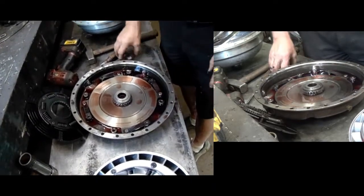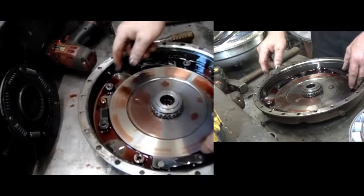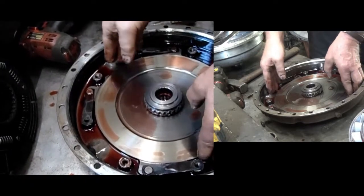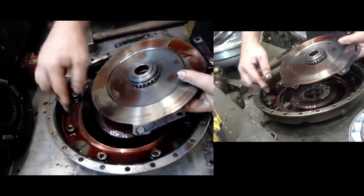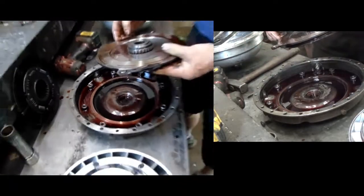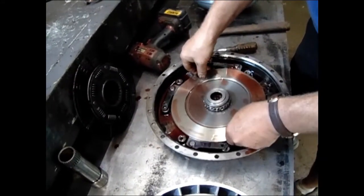I'll point something out because I've seen it many times, and in fact when I was younger and dumber I made the same mistake myself. This pressure plate here has to go in the right position. It's possible to install this thing 25 degrees or whatever it is out of position. You say, 'Oh yeah, what difference does it make?' Well, when the clutch releases, the pressure plate comes and hits this raised spot in the converter housing, and it'll break the tab right off. Then you have direct drive for the first three shifts, and now it doesn't work anymore.